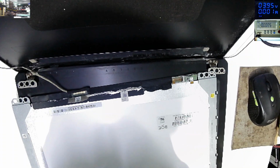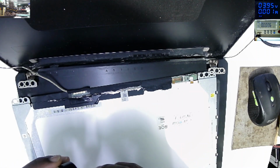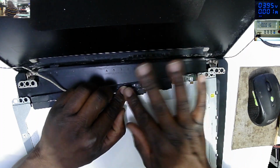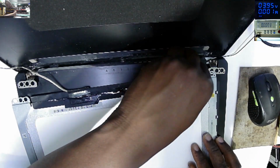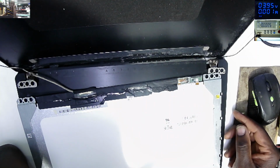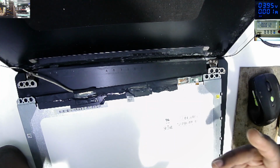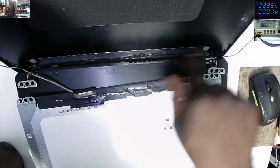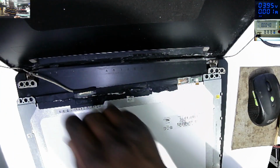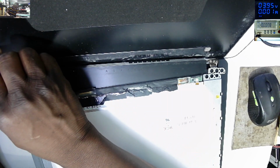Yeah, it's very disappointing. It's very disappointing. We try to fix something, we fail. The next thing, we take out components from the customer's device. So what I think was the initial problem was the backlight according to the customer's description. Based on the fact that the hinges were broken, probably this connector wasn't properly connected. And I don't know what they did to the moment they blew up the fuse for the 19 volts, which is going to the screen.